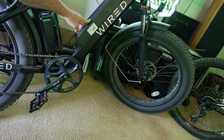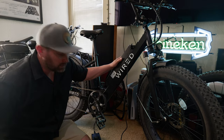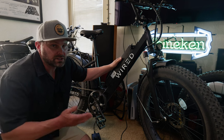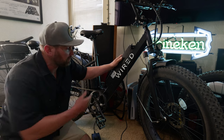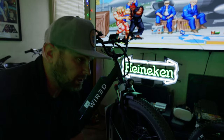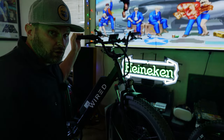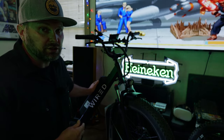This is a 60-volt, 20-amp-hour battery. Multiply 60 volts by 20 amp-hours and you get 1,200 watt-hours. This is a 3-amp charger, so every hour it's replenishing 3 amps. Divide 20 by 3 and you get 6.66 — which is possibly why this company called themselves Wicked E-Bikes before they had to change their name. Watts are volts times amps — Ohm's law. This battery can sustain a load of 1,200 watts for one hour. Since the bike can put out 2,400 watts, if you're hammering the throttle the battery will last you about half an hour.